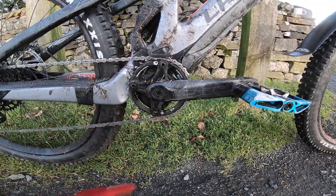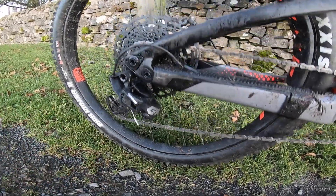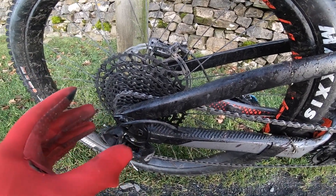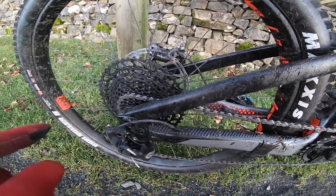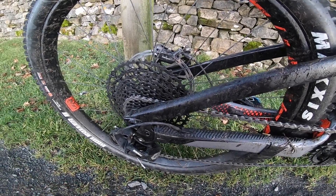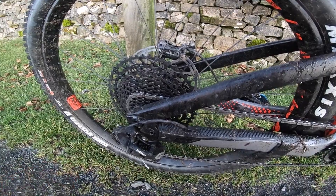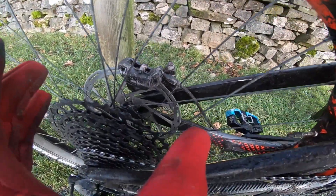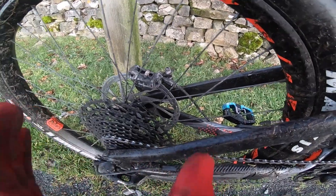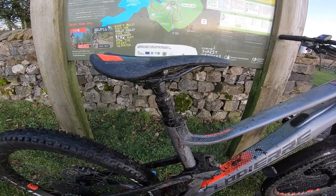There's no problem with chain wear — it's fully replaceable, with an X-Sync 2 chainring pattern so the tooth profile is really good for sharing chain wear and giving a smooth feel under drive. SRAM GX Eagle on the back with a 12-speed 32-tooth cassette — that's the cheaper-style cassette that goes on a standard splined freehub rather than an XD freehub. These were actually the first cassettes SRAM listed for e-bike use, marked out as the toughest and most reliable under that extra torque. They really haven't skimped on the braking — SRAM Guide RE brakes with 200mm rotors front and rear, which is an awesome sight on any bike, especially an e-bike.